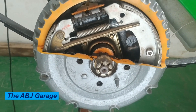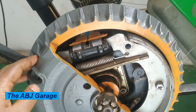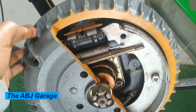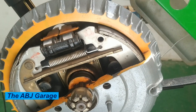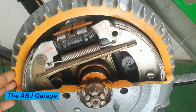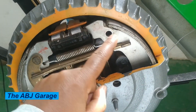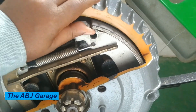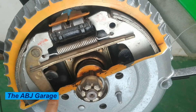Let's have a look at some of the several components of the brake system. One: the brake drum. The brake drum is a circular metal component that is mounted on a wheel hub. It rotates along with the wheel and provides a surface for the brake shoe to press against. Two: the brake shoes. These are curved metal plates that are lined with friction material on the outer surface. They are mounted on the stationary backing plate and are positioned inside the brake drum.